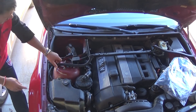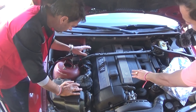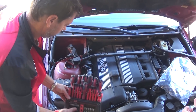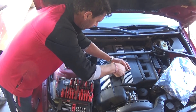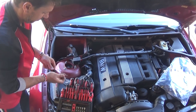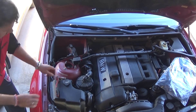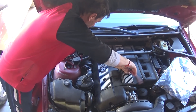We're going to clean ours before installing everything back together. Now we have to remove that cover and one more cover there — we need a small flat-head screwdriver. You're supposed to have two caps here but we only have one; one is missing, and the back one for the spark plug cover is missing as well. There are two bolts with a 10mm socket — they're pretty short bolts.